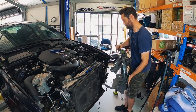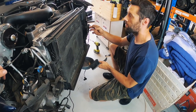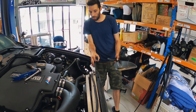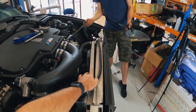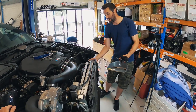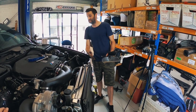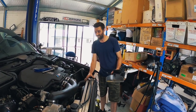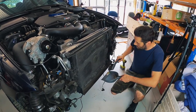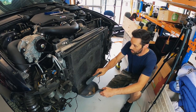Radiator support removed - easy as that! After we pulled it off, from when it rolled into the car in front it did bend the radiator a little bit. Once the bent rad support panel was off you could see the top corner was bent in. All I did was grab the side of the tank and pivot it on its mount up against the chassis rail, put a little bit of pressure on it - not too much - and it looks like it's straightened up again. Time will tell if it leaks, fingers crossed. We've also got access to the condenser, so may as well give the fins a bit of a wipe and clear away some rubbish.